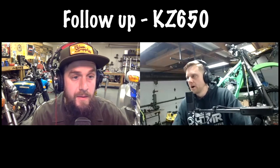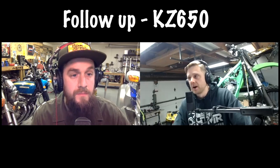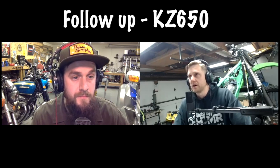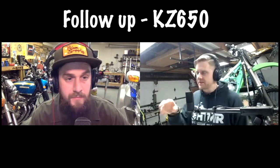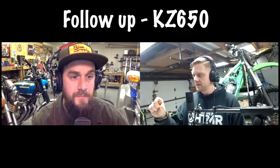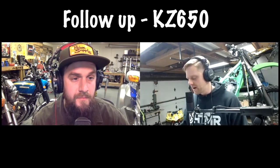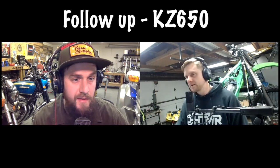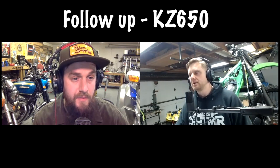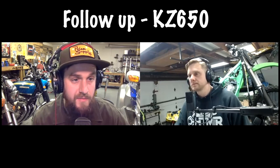Right. I have some videos on that because I went through that with the Chevelle engine. Cool. I had a lot of leakage past the valves in a leak down test. So I did all that. I think I put some solvent in there, and I did some measurement with a dial indicator. Yeah, you can do all that stuff. Gas is super thin, and it will leak if it's not seated all the way. Yeah, absolutely. But his question was about carb stuff.